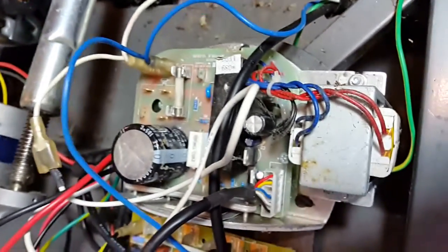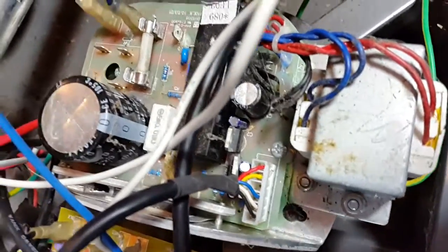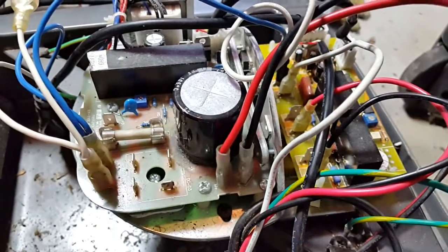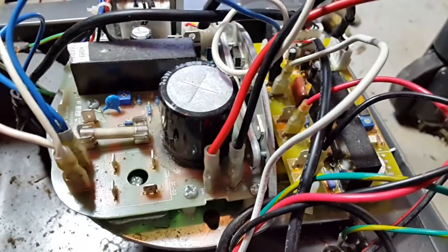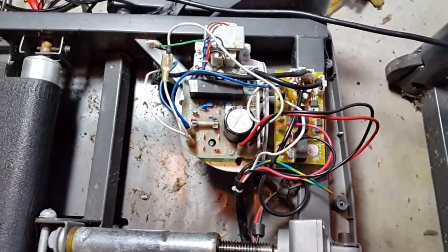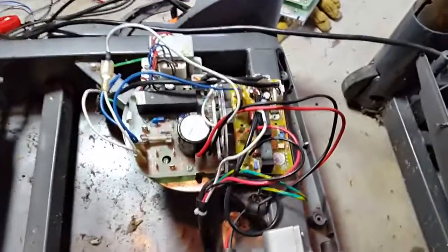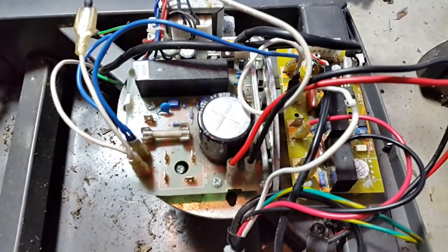The choke here is hardwired into the controller, so we don't have to worry about that. The only other wiring is for the drive motor — this red wire and this black wire right here are the wires going to the drive motor from the controller. If you zoom out you can trace those wires back properly. That's pretty much how you would wire this up on a Smooth 5.25 or FX 25.